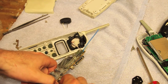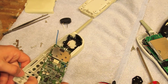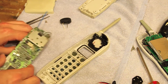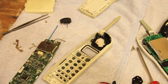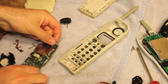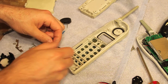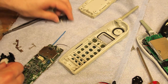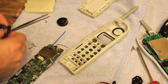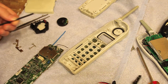So now I guess I'll have to get out the soldering iron and solder these, which is not my favorite thing to do, but I'm going to do it anyways because that's just the best way to fix it. Unfortunately these two receiver capsules are not really perfect replacements — in fact they're probably just about as far from perfect as you can get, they're just about to cross the line of not working. But this has terminals on there and this doesn't, so we're going to have to make a connection between these two wires. So what I'm going to do here is take this shrink tubing.